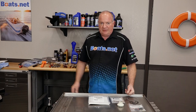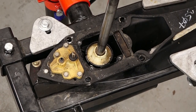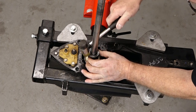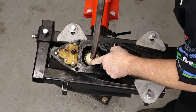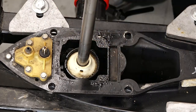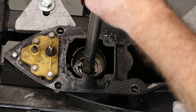So if you're ready, we'll get this thing finished up. We need to push down on the seal carrier so we can remove the ring and then it'll lift off. What I'm doing with this collar is just seeing if I can get it to pop loose. Just push it down ever so slightly. Now we can reach in and get that ring out. Not a lot of tension on this. As always when you're pulling something like this apart, lay it out on the table as it comes off the unit — it makes it a lot easier to put back together once you're done.